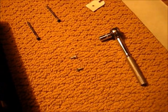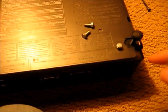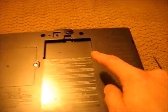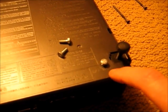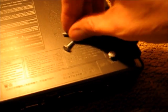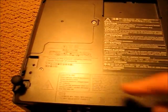Let's take a look at what we'll need. First of all, screws. We'll need about three screws or bolts that go into the bottom of the projector. If you look, your projector has one, two, three holes for mounting. Yours may have more, but usually they have three. Right here it says M4X8 — you can go to the hardware store and ask for a screw that will fit that. Just get a short one, like half an inch or so long. Get three of those.